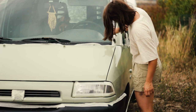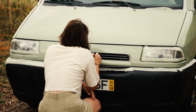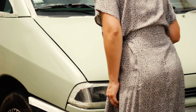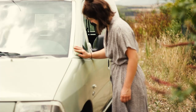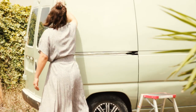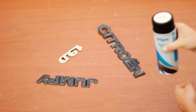That morning I touched up the places where the roller didn't get with a brush and after the paint had dried I sanded the entire van again. This time with an even finer sandpaper so that the second coat would adhere better and loosen the dust and small insects that had got stuck in the paint.